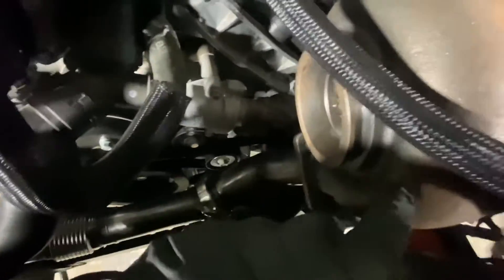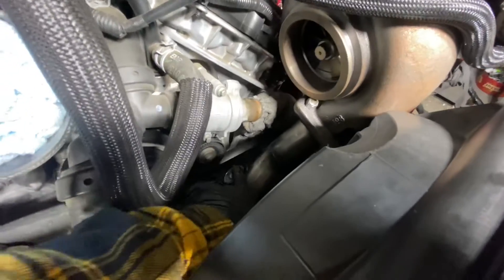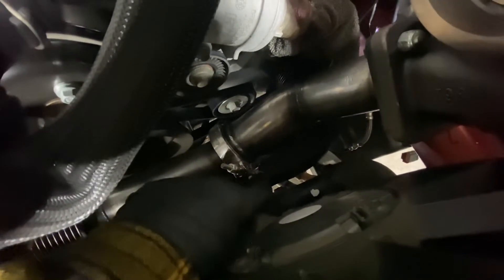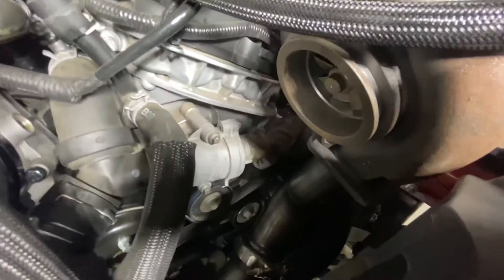If you get a CG Fabrication kit, you're going to have to figure out the radiator bottom hose. It comes out straight and then gets an S-bend that was in the way of this pipe. What I'm going to do is run something up and over this pipe using a 90-degree elbow off the water flange. That's a pretty common fitting — it should come out and then bend here, and I think I'll have just enough room.